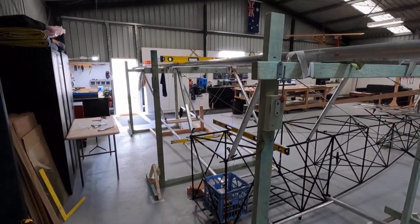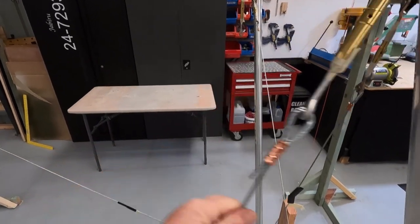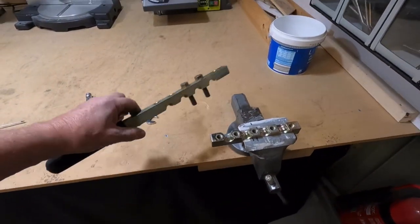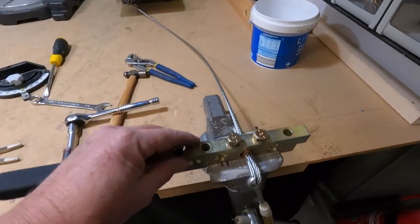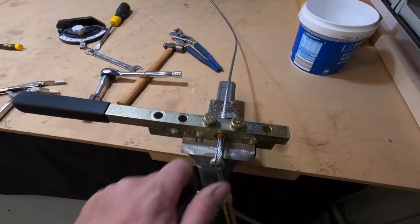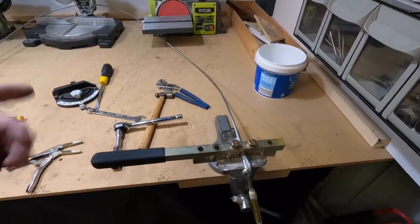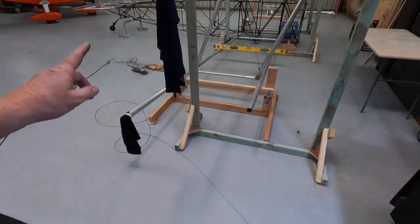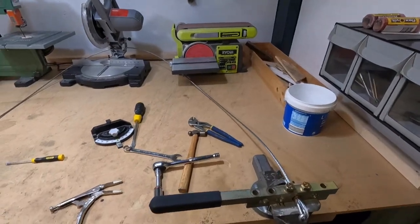My first swage on the big ones. A good little tip is to mark the center of these. I'm using the Aircraft Spruce tool — this thing seems to swage them down okay, just work them down. It's a bit laborious but I just did one and had to cut it off. This is a death rope basically, so it has to be perfect. A balls-up on one using that process — it's a bit like you take it off and get a surprise with what you've got left. Also with this cable, which is pretty expensive, I've marked my four lengths and you don't want to waste — you don't want to go wasting six-inch tails because you'll run out of this three-sixteenths cable. Just a point of note.